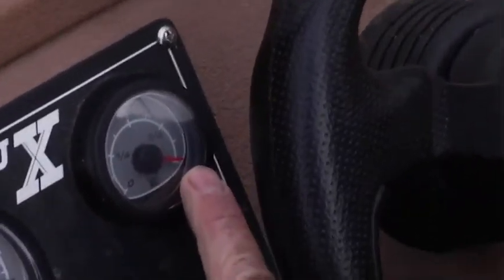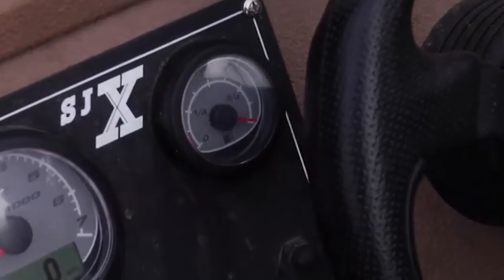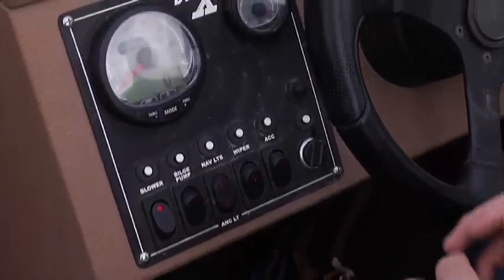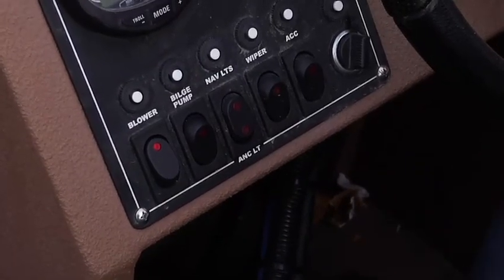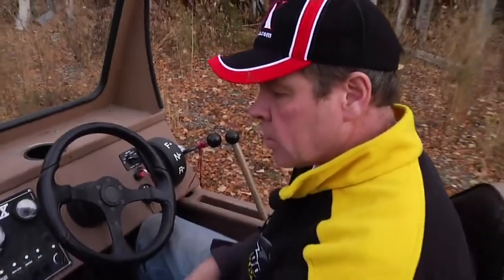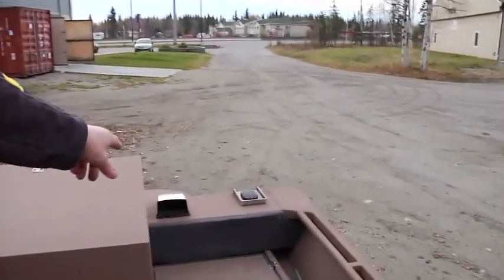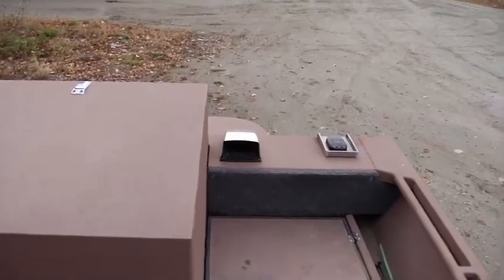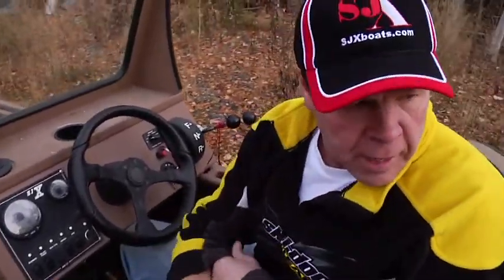You have an analog fuel gauge that matches your fuel percentage gauge. These tanks are 40 gallons, so at half a tank you have about 20 gallons left. Before starting the boat you should always hit the blower — it removes any fuel fumes from the engine compartment. The Coast Guard recommends running it for five minutes before starting. Once you're up on step, the louvers on the back of the engine compartment — air intake on the port side and air out on the starboard side — remove the need to run the blower, so you can shut it off.